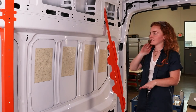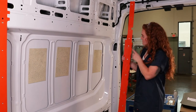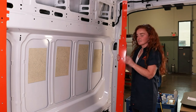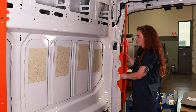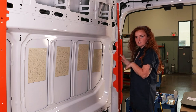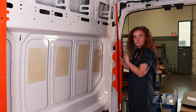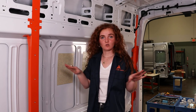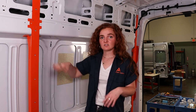Now that TX 3.5 is all set and in place, we're moving on to TX 4. Again, this is a mirror image to the other side — it still has the placement tabs, one at the top and one at the bottom, and it's going to hug the edge of this D-pillar. Remember, we have to drill out behind the pem nuts just like we did with the aft bracer — important to do before setting rib nuts. I'm going to put in set screws, pre-drill my holes, clear the metal debris, set my rust preventative, and then set all my rivets and rib nuts. Now that TX 3.5 and TX 4 are mounted, the bed install kit bracing is totally installed. The only step after this is to mount your L-track — all labeled with corresponding labels 3.5, 4, 1.5, 2 — mount those with the M6 bolts and you're set to install your bed.